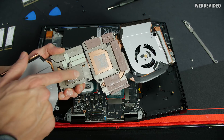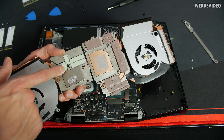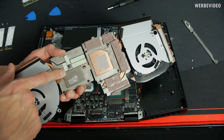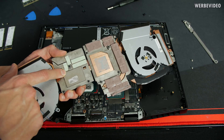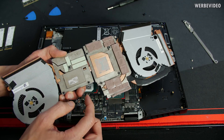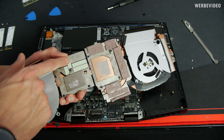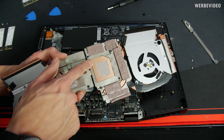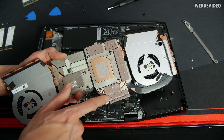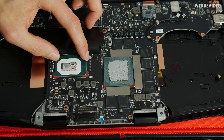From underneath you can clearly see the area where liquid metal is applied to the CPU. What's extremely well made is that this contact surface is nickel-plated copper — that was one of the most critical points notebook manufacturers had to address. You cannot use naked copper with liquid metal or gallium, because there can be corrosion effects or the gallium can absorb into the copper. Nickel plating prevents this. The GPU area uses conventional thermal paste with thermal pads for GPU memory and MOSFETs.